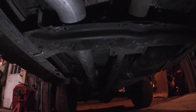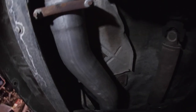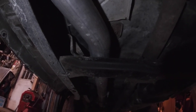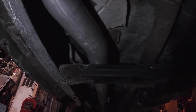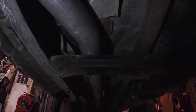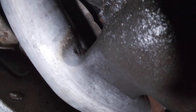Alright, so first assessment down here. This is a 4-inch exhaust kit that I put on this truck. Turns out, nobody makes a 4-inch exhaust kit for a Cummins and a crew cab '78 Dodge. But these frames being very similar from '72 to '93, I ended up buying a kit for, you know, an '89 to '93 club cab long bed, or whatever years they ended up making them. The club cab long bed was very similar in wheelbase to the crew cab short bed, and everything fit really nice except for this spot here.